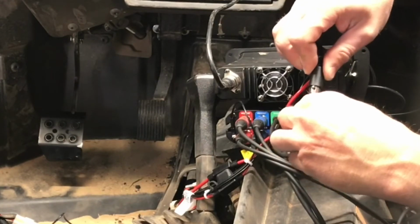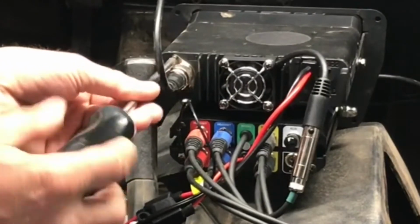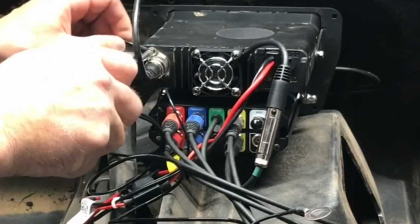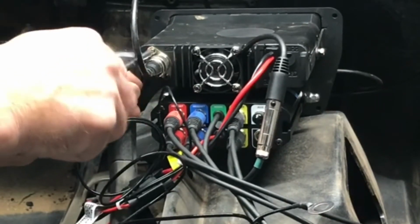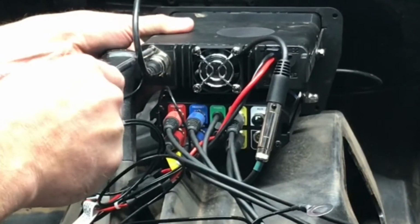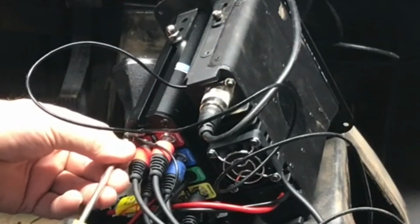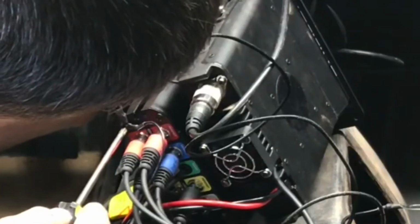There is also one more of those connections to connect the intercom to the Bluetooth. There is a ground wire that you need to attach to the intercom and to the Bluetooth, and it also goes to the active filter. On the intercom, I used one of the bolts that was holding where the coax plugs in for the antenna. And on the Bluetooth, I used one of the back cover bolts to secure the ground to that. So basically, I ran the ground from the active filter to the Bluetooth, and then ran a second ground wire from the Bluetooth to the intercom.